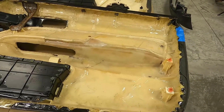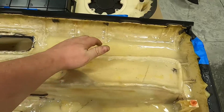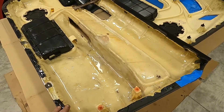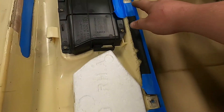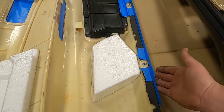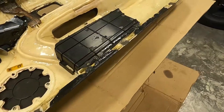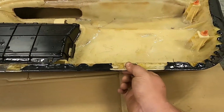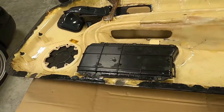This door was a lot worse than the passenger side — a lot more pieces missing and a lot more cracks, but this thing is now solid. For about a hundred dollars in materials I figured I'd give this a shot and I think it's going to work pretty well. Another common issue is that the mounting points break completely — it gets really brittle around those mounting areas and just cracks and falls apart. What's going to happen is those areas get filled in with epoxy, making them solid. I'll have to re-drill the holes, but the mounting points should never break again. You can see they're very rigid — there's no chance this mounting point is going to break.